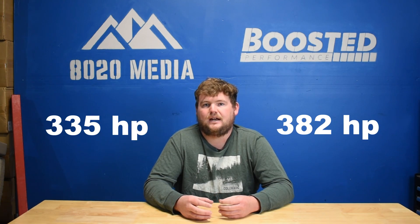Looking at the original BMW B58 engine — still an awesome, very capable engine — it came from the factory with anywhere from 322 to 355 horsepower. The B58 TU1, predominantly used since about 2018, makes anywhere from 335 to 382 horsepower, with a middle tier and an upper tier output at either 335 or 382 horsepower. One of the biggest updates moving from the original B58 to the TU1 was BMW moving from a 200 bar high-pressure fuel system up to a 350 bar high-pressure fuel system.